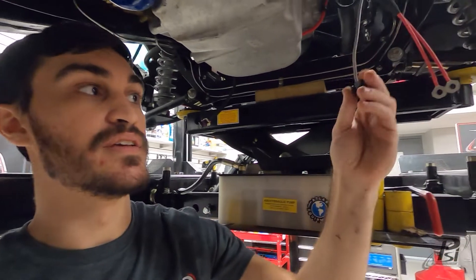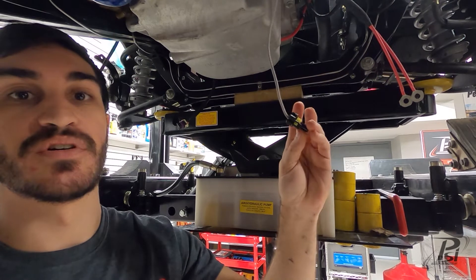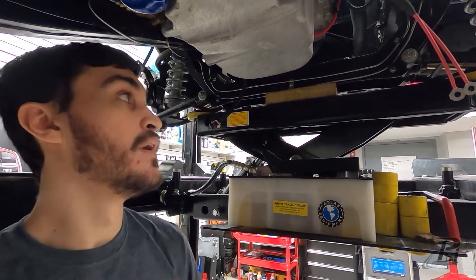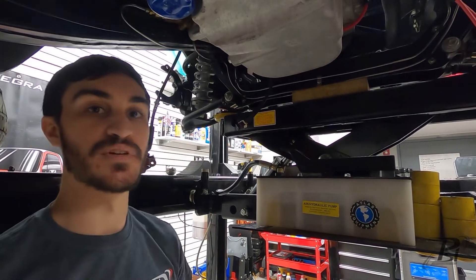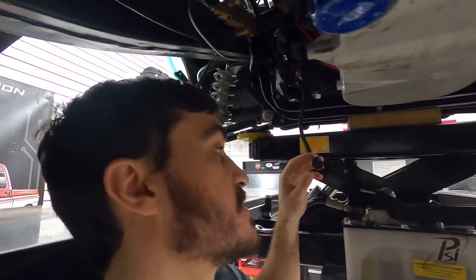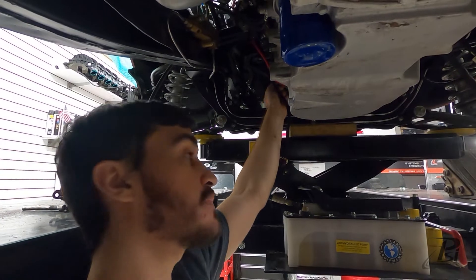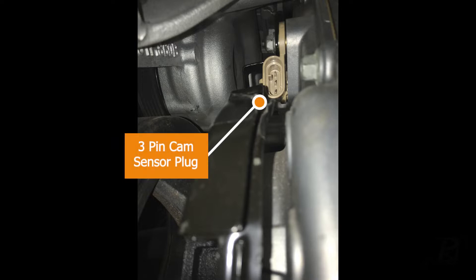The other thing with the starter is this crank signal wire — you're going to need to pull this from your ignition switch, which is going to be on your chassis wiring, which is why it's not included in the harness. You are going to need that to start your car. Also important to note on these manual harnesses: our three-wire cam sensor plug does not plug into the sub-harness. I unplugged the cam sensor up there and that's where our harness plugs in.